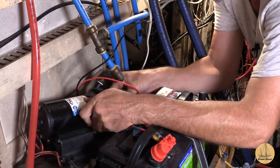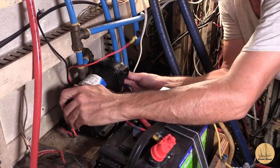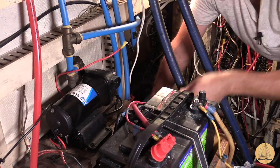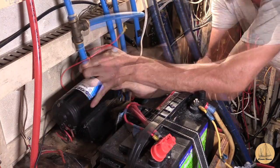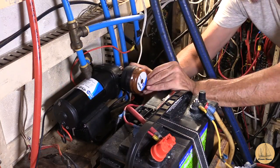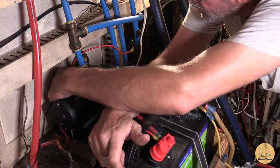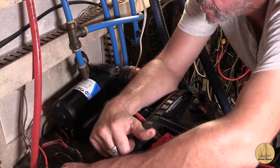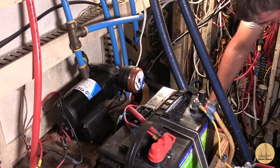Now as we go back into the engine room, again it's a reversal of the process. I'm starting by connecting up the output line to the side of the motor, going ahead and putting on the inbound line from the tank, and connecting up the wire connections. I'm doing a little testing here, but I'll come back and put shrink wrap over these again, since I had to cut the shrink wrap on my connections when I took this all apart. At this point it's ready to test out. Thanks for watching.